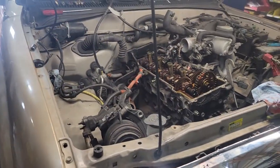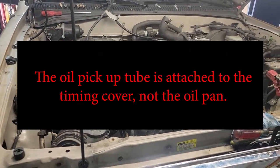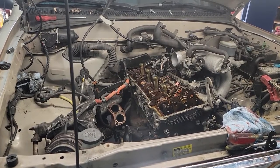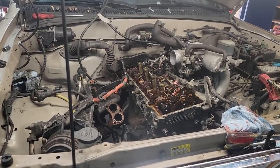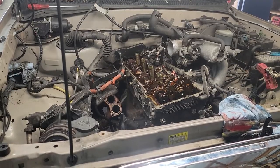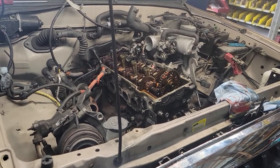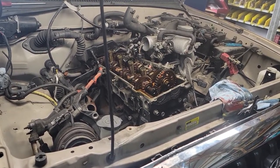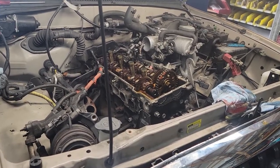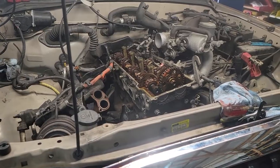At this point I realized that I messed up. The oil pickup tube is attached to the oil pan, and the only way to get the oil pan down is to either pull the engine up quite a bit or completely take the engine out. Neither of them are fun to do. You have to disconnect both sides of the motor mounts, the transmission mount, and then pull up. I'm still focused on trying to get it done with the engine in the car.